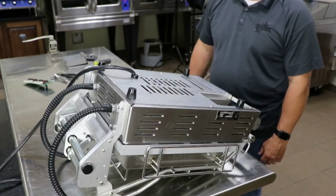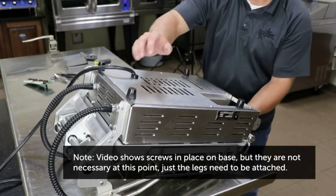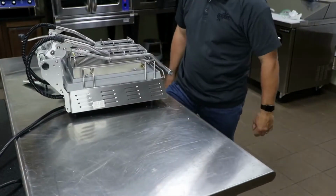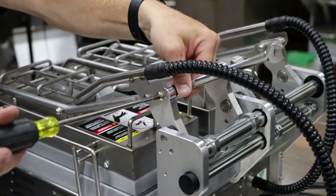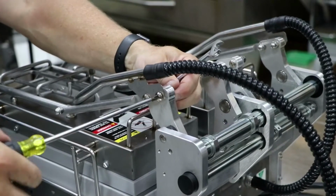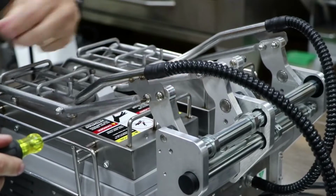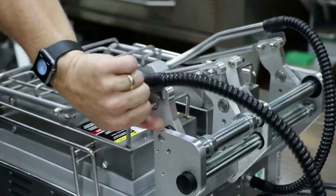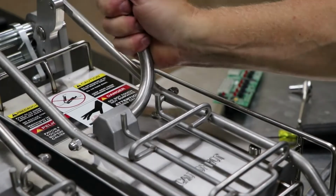Flip the unit over onto its feet, being careful to hold onto the 2 top lids so they don't spring open during the process. Remove 2 7/16" cap nuts, 2 lock washers, and 2 1/4-20 Phillips screws from the metal conduit retainer. Then pull the metal conduit from the top housing block with a little bit of a twist.